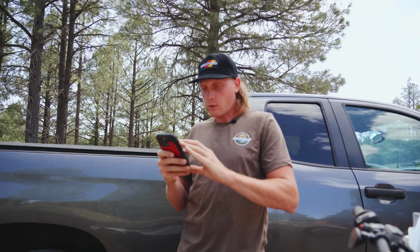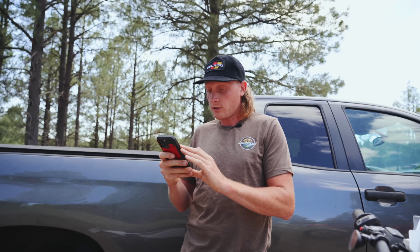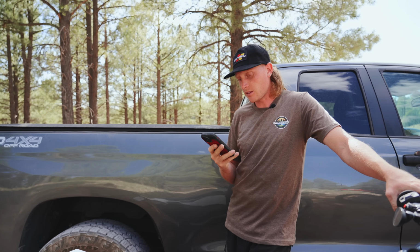So we'll take 625.475, you can go ahead and round that, I don't feel like doing it. Subtract that by your static sag. Mine was 584.2, so I ended up getting 41.275, and the spec is 37 millimeters for this bike. So we're a little bit off.